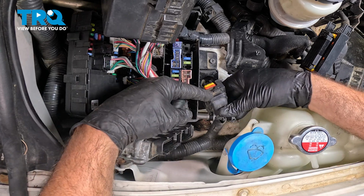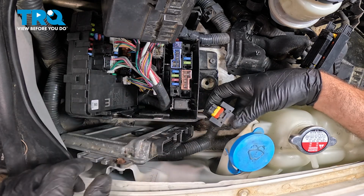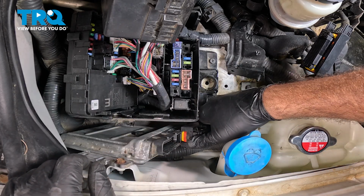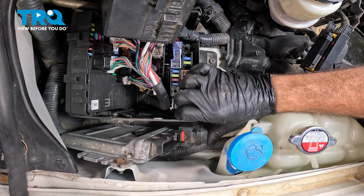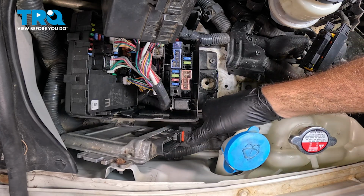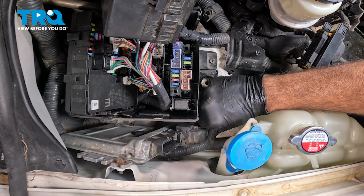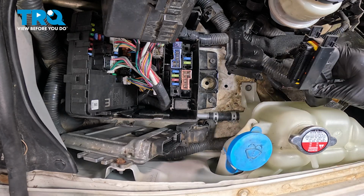Now on the connectors, you have the little bulkhead latches here. So you want to make sure that those are pushed all the way to the top. Line this up. Push that in. Now you're only going to get to a certain point, and then as you fold this over and latch it, it will actually suck in the connector and lock it into place.